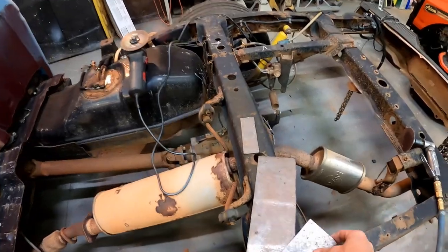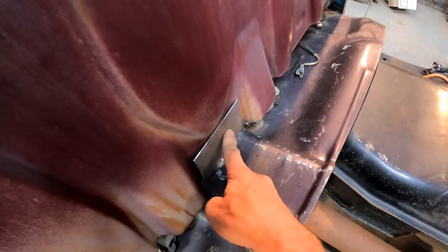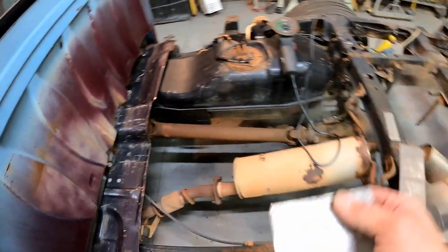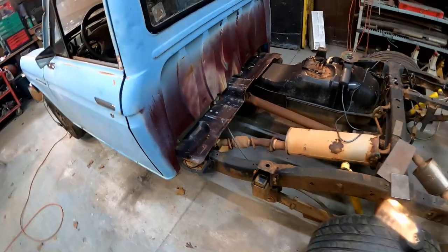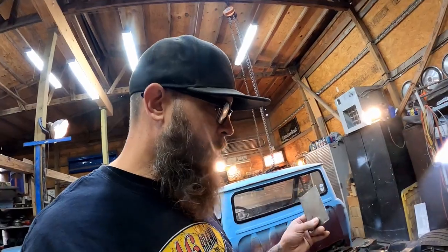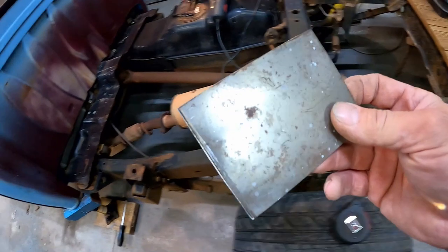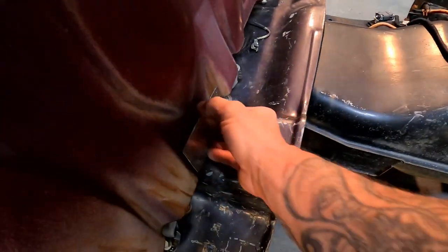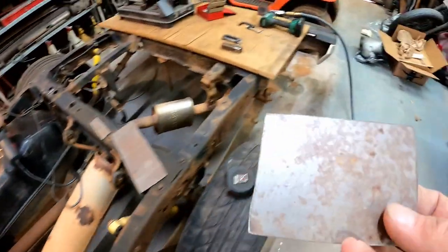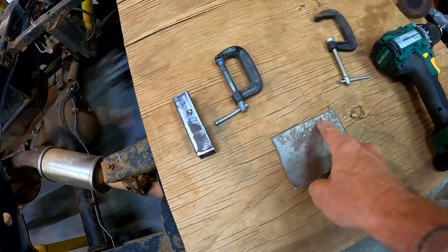What I'm going to do is make a filler piece for the rear that's going to come right here in the middle, fitting up inside there like that. But we've got to do some bending and some drilling and all that fun stuff first. So here's my setup — I've already got my piece trimmed up. I'm going to go ahead and drill my holes in it for the spot welds. I want it to fit right inside of here, fits in between there perfectly. I'm going to put about four spot welds in it, doing it on top.